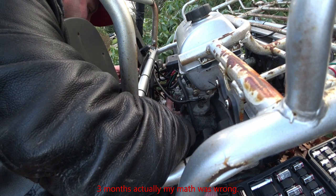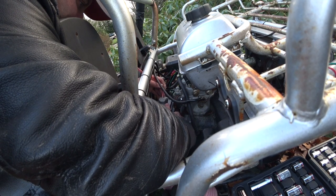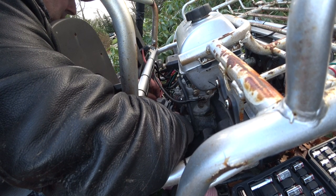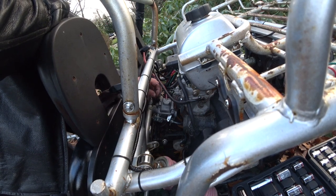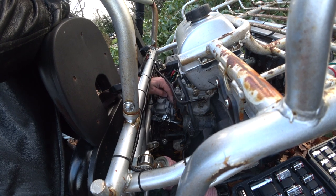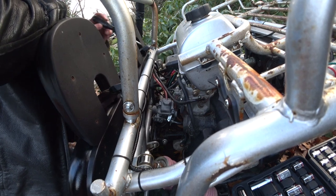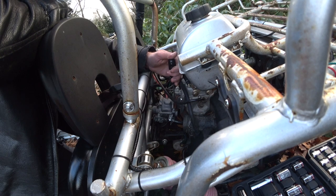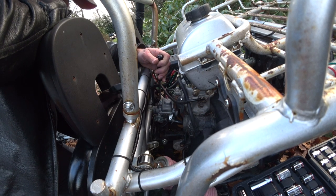Let it think — does this go? It goes this way. I kind of like these newer carbs — they've got these bowl seals and you don't have to replace them every time. That is wonderful. So I just put the cover back on — it can only go on one way, so there's no mistaking it. The little square part on the back goes by the float part where you're pinning. I haven't been using the impact gun on this. I don't love using guns with these small screws — the last thing you want to do is strip them out on the way in, make it way too tight and then you never get it out again. Because I can almost guarantee I will be going through this again at some point.